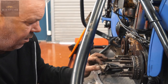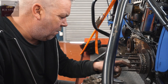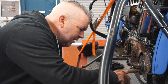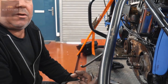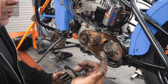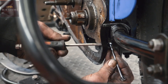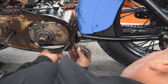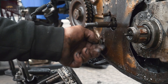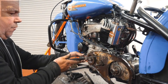Anywhere where there's basically grey muck — that's either bearings or aluminium in pieces. Yeah, this shouldn't be here at all. These should have special lock tabs in them as well, that are missing — just to stop all that letting go and hitting the inside of the chain case. Now if there's one thing you should have put thread lock on, it was them.